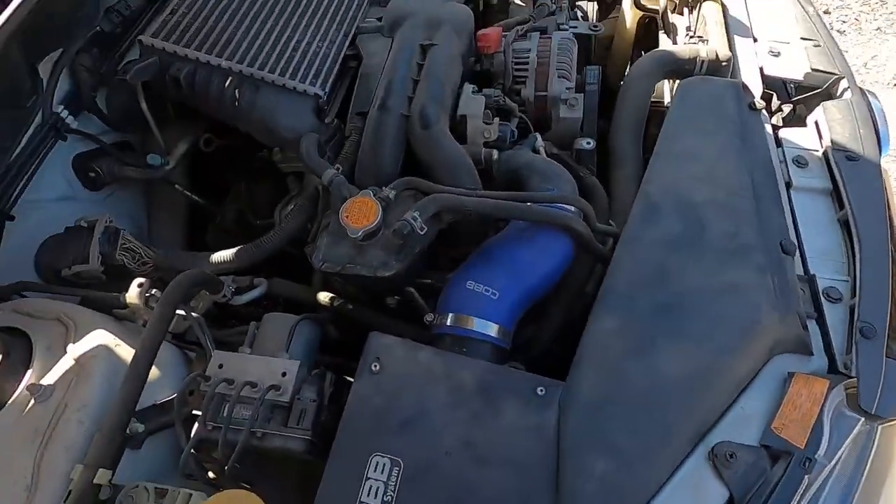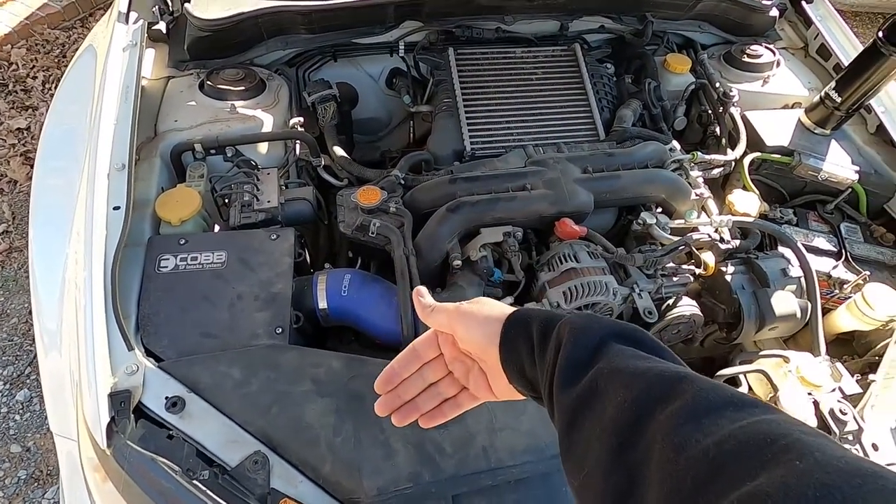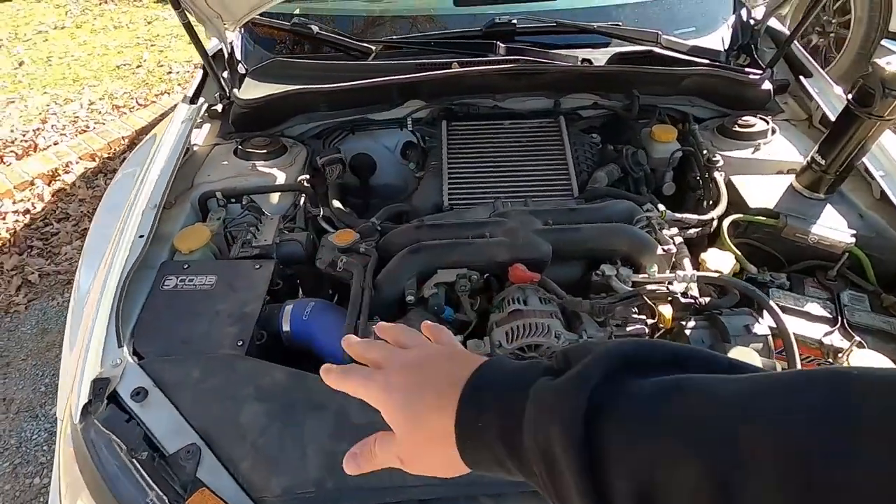Finally last night I did a little pull and I was data logging to try to get to the bottom of it, and it actually threw a check engine light for cylinder one misfire again. But like an idiot I didn't have the misfire tables turned on in the data log, so it wasn't recording cylinder one, two, three, four misfire or spark advance or any of that. I had a CEL code for cylinder one misfire. For y'all not familiar with Subarus, cylinder one is the hole closest to the front passenger side — which is conveniently the easiest one to get to.